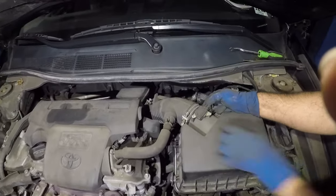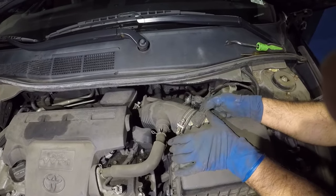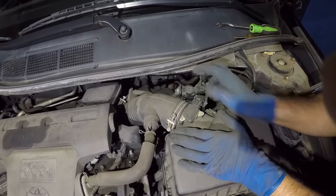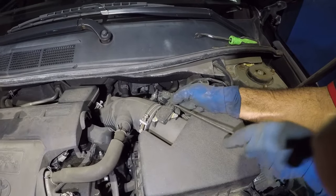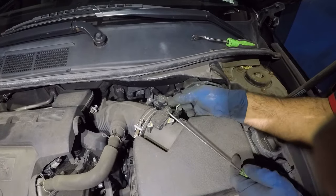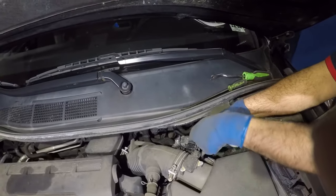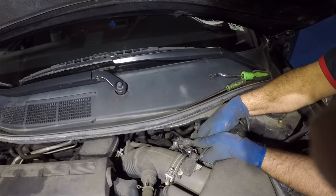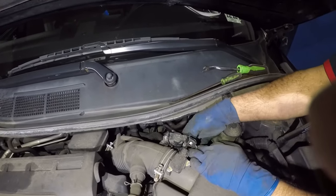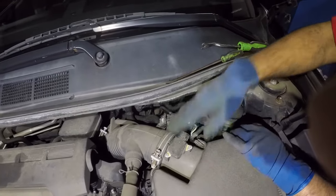We're gonna remove this little guy right here. Make sure the key is off, and the sensor should come off from right here — just push on this. It's gonna be really tough, so I'm gonna go get a pick. With the pick you can lift this little clip right here and this connector will come off. After that you got another connector down here for this evap sensor — just disconnect it. Then we got a little hose on the bottom, just push on that clamp and pull the clamp back, and remove the hose.